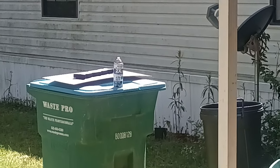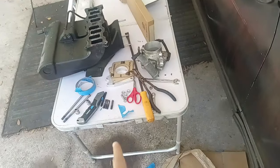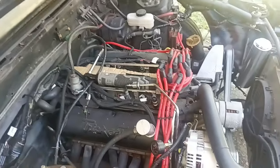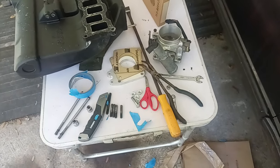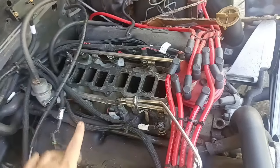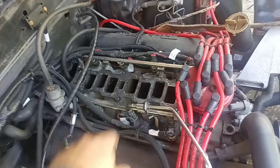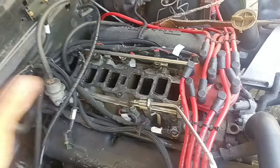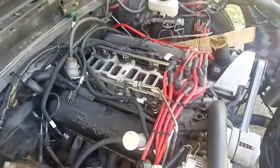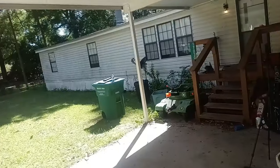Got a coat on that. While that's going, I need to get the new studs in. Remember the two metal ones are the long bolts, so you only put studs on the four corners. Now would be a good time to get this cleaned up before you put the studs in so they're not in the way. Stuff something down in the intake runners so no debris falls in — most of it will burn up if it does, but better safe than sorry. Got the surface clean, now I can put in the studs and put another layer of paint on the spacer.